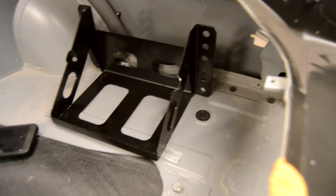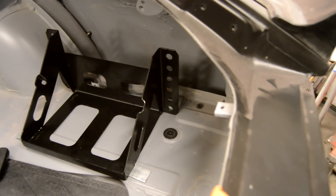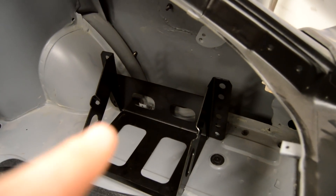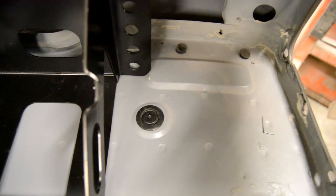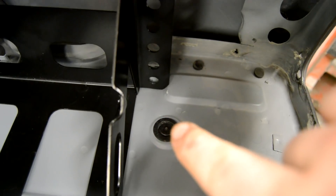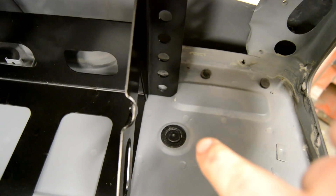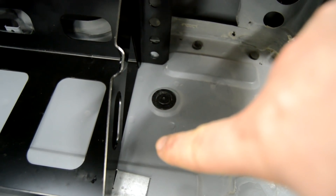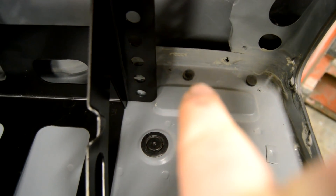Those L-brackets that I was building for the back — a little change of plans. I actually have to switch this L-bracket to be on the back side, and then I can't build one over there, but I still have a way to mount it. You see these spot welds here — this kind of square deal — that's actually the frame rail for the trunk, and where I was going to build the bracket would have come out right in the middle of the frame rail. I don't want to be drilling any holes in the frame rail and it just wouldn't be easy to work with, so I would have had to bring the L-bracket all the way out here which would just not have looked right — pretty much not ideal.